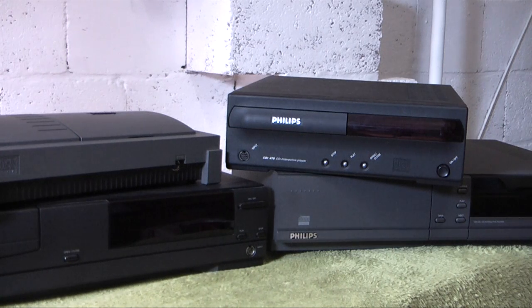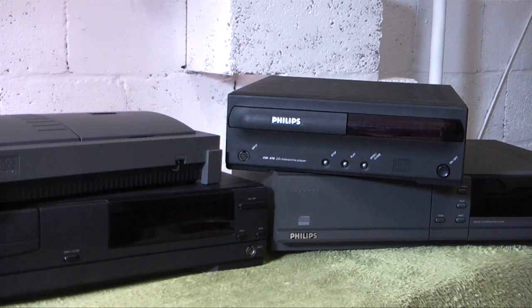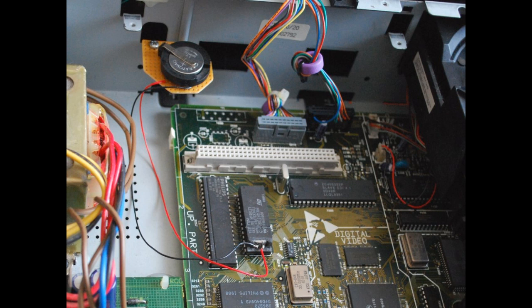These batteries are meant to hold out for about 10 years. Problems can range from just not saving your games anymore after powering the system off, to just not booting up altogether. So really, if you buy a CDI, make sure it works, or that you can fix it. But it's very hard to fix, since you need to open up the chip and solder in a new battery case and battery, of course.